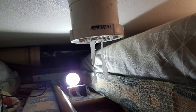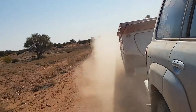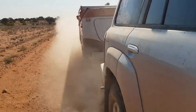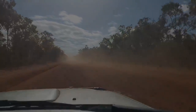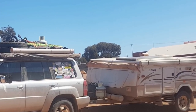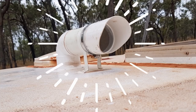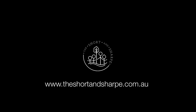To see how it performed I stuck strips of toilet paper on the vent outlet, attached a camera and lamp in front of it, and set off for a drive. At around 70 km/h, which is roughly what I'd be doing on an unsealed road, it is clear that there's a good flow of air coming through the system. On the track you can see that most of the dust goes past the van and not up onto the snorkel. But when cars are coming towards you some dust does get in — most of it is trapped in the polyester filter. I did try a normal snorkel sock to see if it made any difference, but it didn't and the sock got clogged very quickly, so I just went back to the polyester filter. I now have a positive pressure snorkel that I'm happy with.